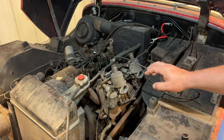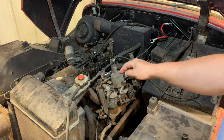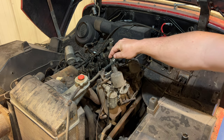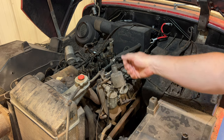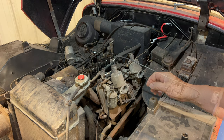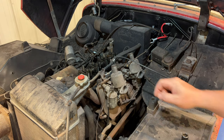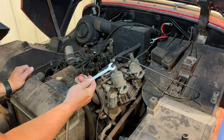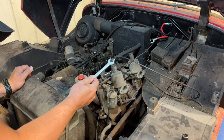I've done this several times before, so I'm going to try it again. I'm going to leave everything attached here and just unbolt the exhaust and the intake manifolds from the head. Then I can just set them aside and take the head straight up. The trickiest bit to get to will be the bypass hose, which goes between the water pump and the head, but that will probably just break when I go to remove the head anyway. These nuts are quarter-inch Whitworth; it's going to take me a while, but I should be able to get in there.